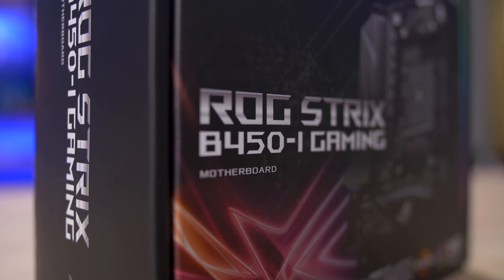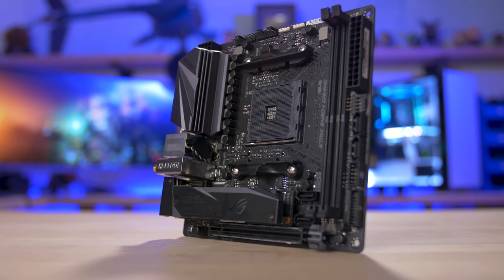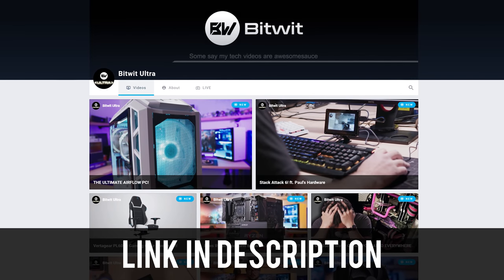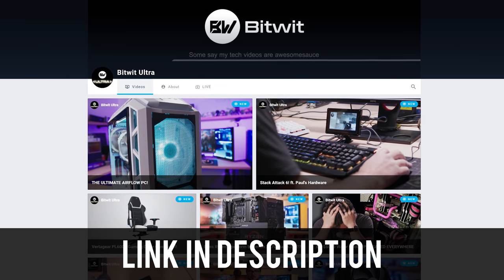Additionally, this board is probably the better value over the X470 equivalent because they seem pretty much exactly the same except for the chipset. Unless you really need that extra IO — USB 3.1 Gen 1 and 2 and maybe a couple extra PCIe lanes — and since you can't really utilize multi-GPU configurations at all on Mini-ITX anyway, X470 doesn't seem to make as much sense in this case. Those are my findings on the ASUS ROG Strix B450i Gaming. Let me know what you think about this board and the B450 platform as a whole. Feel free to toss a like on this video if you enjoyed it, subscribe for more tech videos, and check me out on Floatplane if you want to watch my videos a week early without ads for three bucks a month. As always, thanks for tuning in — have a good one, and I'll see y'all in the next video.